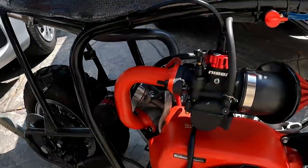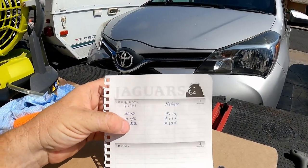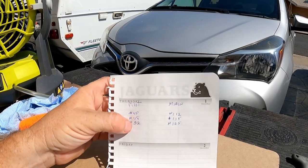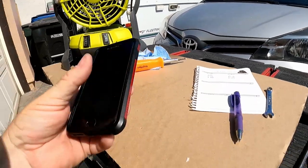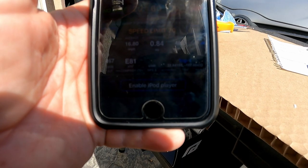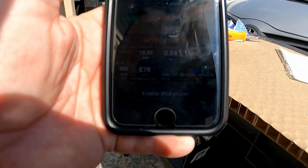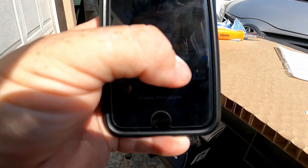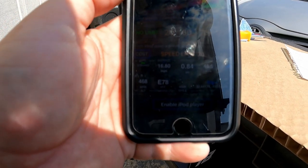Alright, let's take a look at what we got. We've got the new carburetor back on and everything is running good. We went through the jet sizes today. I think the 52 pilot is a little bit much — I might have to go the next one down which I think is a 50; that'll put it right in its sweet spot. But we did get it to an incredible 48.5 miles an hour, and it had plenty more after that. I backed off only because I ran out of road. At 40 miles an hour the hat flies off. Still had throttle left and it was still accelerating — no issues whatsoever.